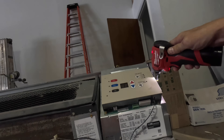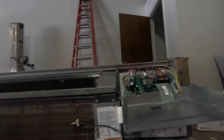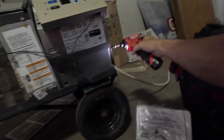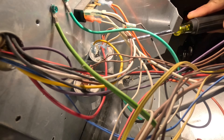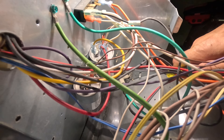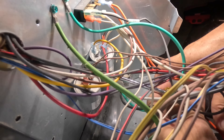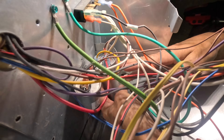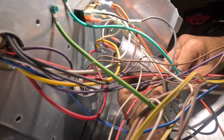Let's get into this. Right now I'm suspecting something - I want to check the capacitor first. It's gonna have one right back there. There we go, that's what I want to check. Let me see what kind of screw I need - this nut driver. Apparently I need a quarter inch.